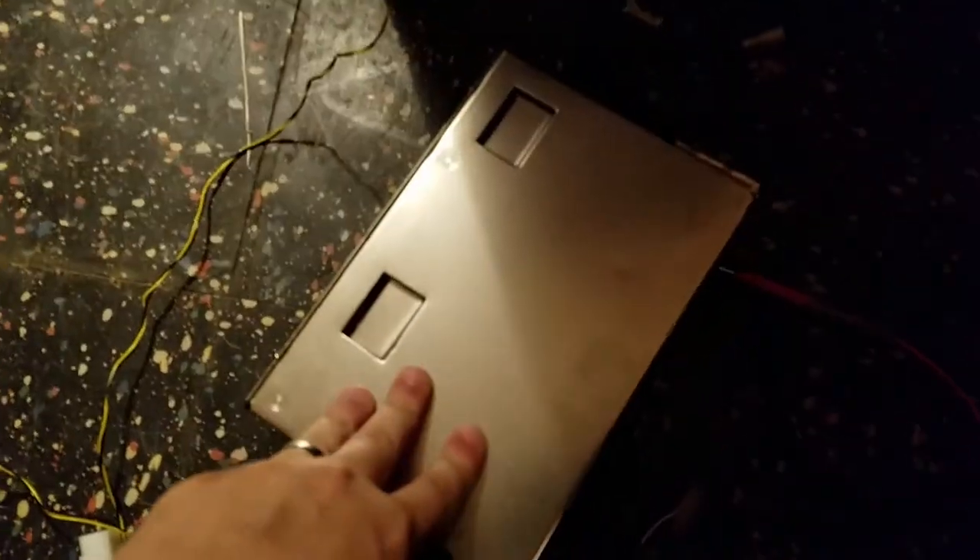Never fun, right? The machine stayed on, strangely, so I turned it off as fast as I could. I came back and realized I had the power for the LED marquee still attached but just kind of floating loose in the cabinet. Those leads shorted on each other, and I think they killed this power supply. The cabinet never shut down on its own — I shut it down.